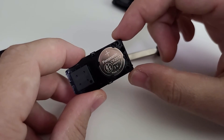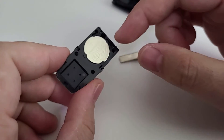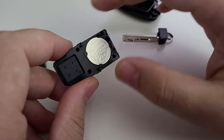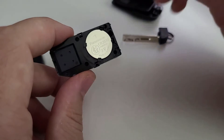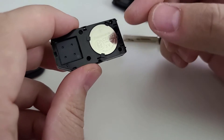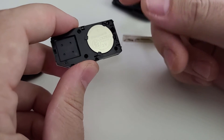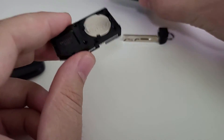This is a Panasonic CR2032 battery. I'll put a link in the description should you need to find one on Amazon — it'll get you to the cheapest one. You can pop this out with your finger or a small manual tool. This is a brand new key fob so I don't need to take it out, but when you do reinstall it, try not to touch the opposite side — where the writing is — with your fingertips, because the oils can diminish the life of the battery.